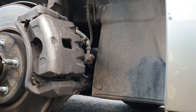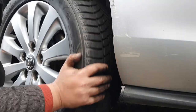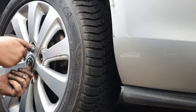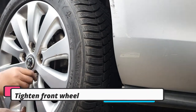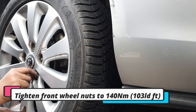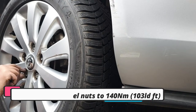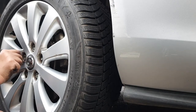The next thing to do is just put the wheel back on. The job from start to finish took approximately half an hour per side, so the job for an axle set is approximately one hour — and that includes jacking the car up on each side, getting the wheels off, and putting them back on again. The wheel nuts you want to double-check tighten to 140 Newton metres or 103 pound-foot of torque.